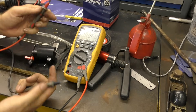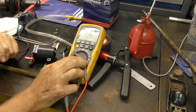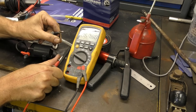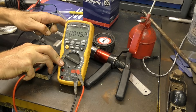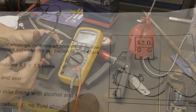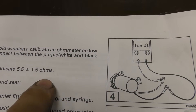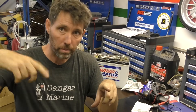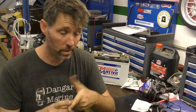The main test of the coil and solenoid according to the service manual is to set the multimeter to ohms, attach one lead to each terminal and see what reading we get. I'm ending up with about 4.5 ohms — that's the resistance coming through the coil in the solenoid. The service manual says you should have 5.5 ohms plus or minus 1.5, so we're in spec. A solenoid works as an electromagnet — simply a coil of wire you pass current through which induces a magnetic field. If that coil is broken, has really high resistance, or a short with really low resistance, it's not going to work. Being in spec gives me reasonable confidence it'll work as an electromagnet.